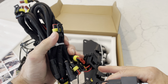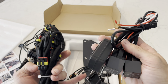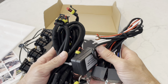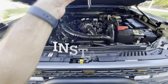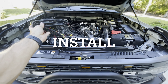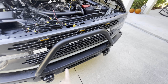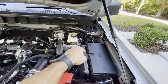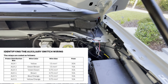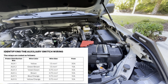Overall not bad. I like the fact that these are waterproof — they're going to plug in. What we'll do next is I'll show you how I've installed them using the auxiliary switches. They do promise 50,000 hours of lamp life, so we'll see how that goes. Let's go ahead and start by laying out the wires and how we want to put this wired from the front of the vehicle — we're going to run the lights down here, up through, and run down the side of the vehicle back to the firewall where you've got your connectors for your auxiliary switches. Some of you may not have those but there is a harness for that.